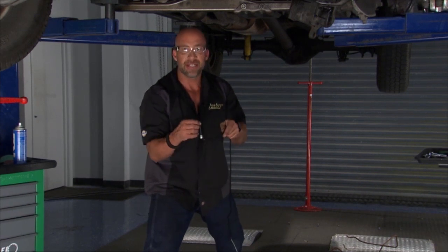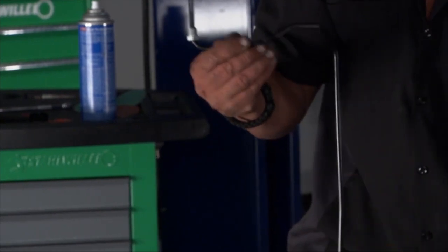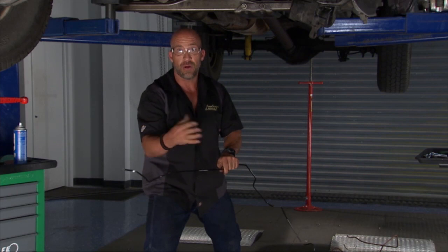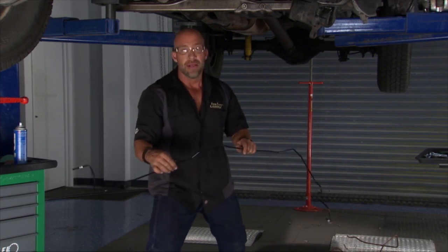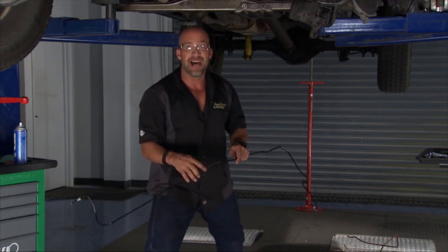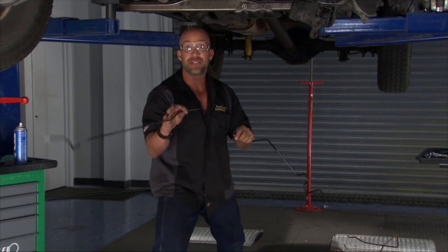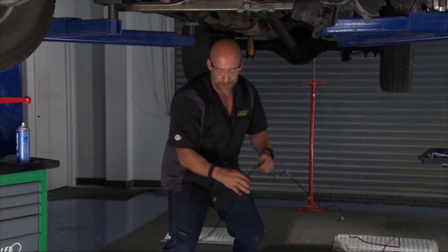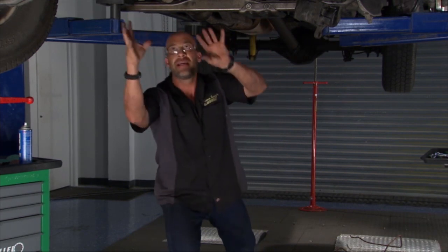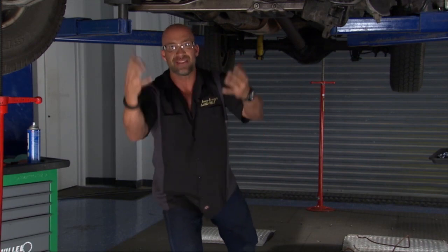Okay? They're protected on the inside, copper, then the finish on the outside. And this nylon coating, super strong, super resistant to any kind of corrosion you're gonna get, whether it's salt or the mag chloride like I was talking about earlier. So basically, when your grandkids are trying to restore this truck 50 years down the road, the only thing they won't have to replace are these brake lines. Pretty sweet stuff, available from AC Delco. All right, I'm gonna get back here, hit it one or two more times. Any spots I missed, we'll hose this thing down, give them one clean ride underneath it.